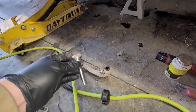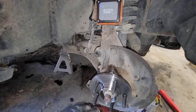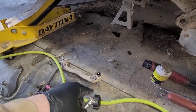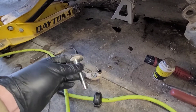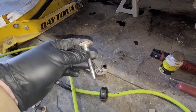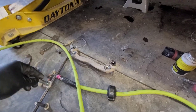It's very important that anytime you do a brake service, it's super easy to go in here and throw a new set of pads inside your caliper and throw a new rotor on and call it done. But you're not done if that's all you do. You need to pull out your slide pins, take off the little boots that seal them, clean off all the old nasty grease if there even is any - I've already done these - re-lubricate them and put everything back together. The driver's side of this vehicle had probably never been checked, and the passenger side here is not that great either.